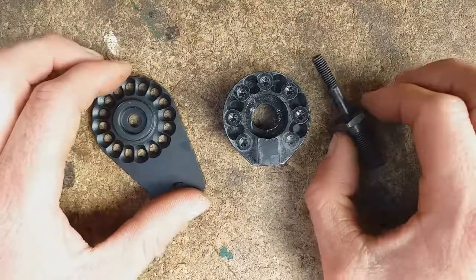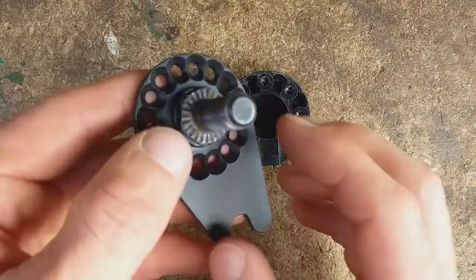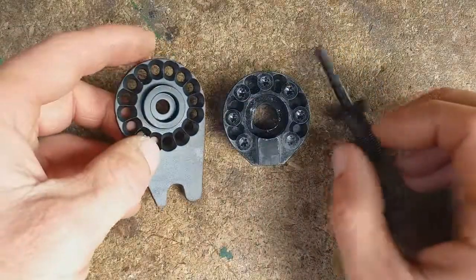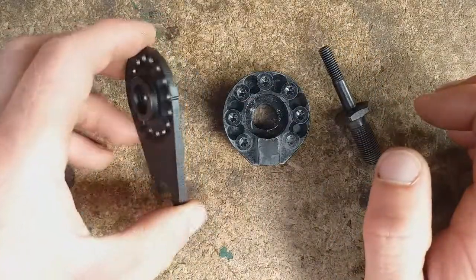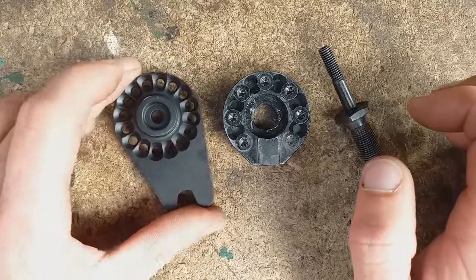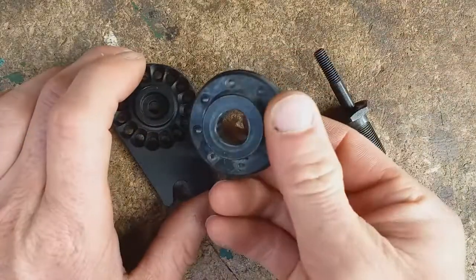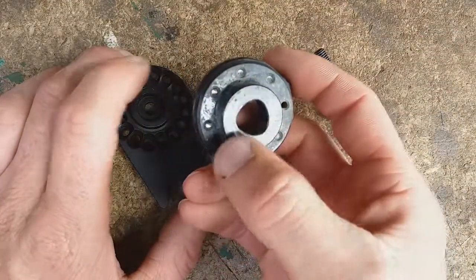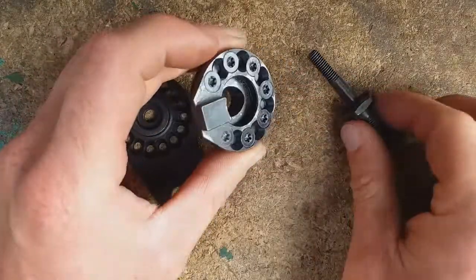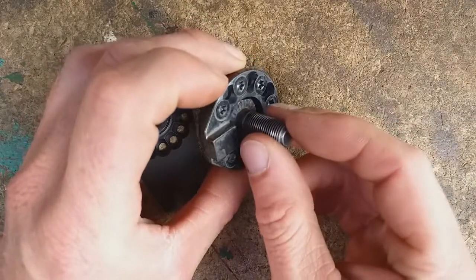Some of you may have spotted that you can buy these with the axle integrated into it, but apparently that is a really bad idea. After thinking about it I realized why — the way Mvolo hubs mount, this mount here is not designed to take an axle on the end of it. It's designed for the axle to go through, such as that.